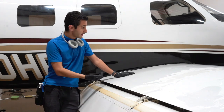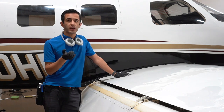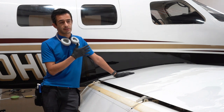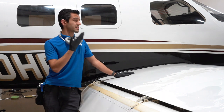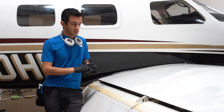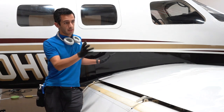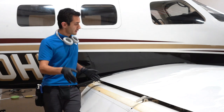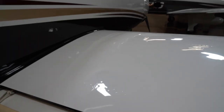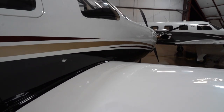The fuselage is polished, even the underside. It's not quite panel wiped yet, but it's 8:30 and coating is going to be like four hours, so I'm working on the wingtops instead. I got the other side polished already. There's a sweet little test spot up here and you can see it's pretty dramatic. That yellowish lack of reflection is because of oxidation — and we've removed that oxidation. There's good paint underneath there.